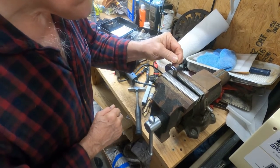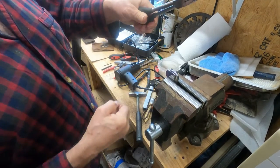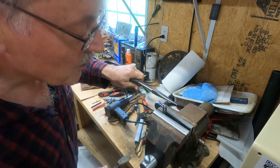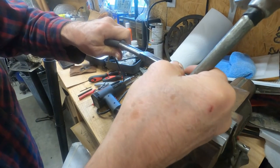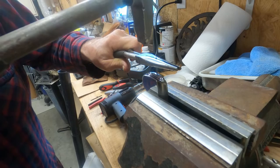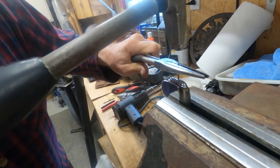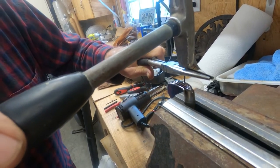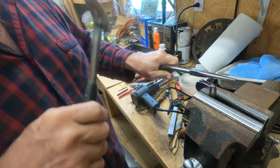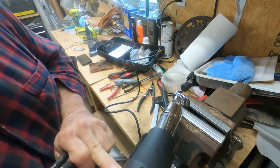So you want to start the pin punch — or there's my homemade pin punch, the base of a drill — and I put it right on where that pin is and you want to tap it out. You want to be careful not to damage your piece. Just get it started so it's got a little start where you can put the pin punch in there pretty easy.